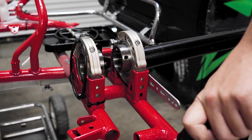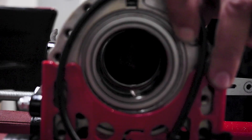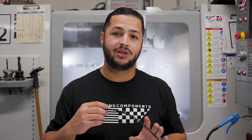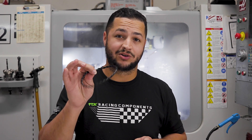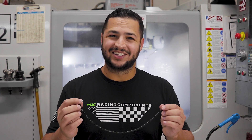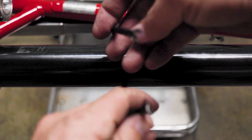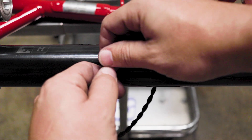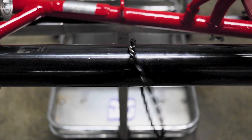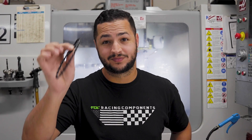Once the bearings are in line, take the axle and slide it through the sprocket side all the way through the third bearing. At that point make sure you don't forget the water pump belts if you're running an external water pump — that's one of those things I've definitely forgotten before. Luckily TDC has water pump belts with a metal clasp that hook together, so if you're tired of forgetting them or want ones you don't have to remove the axle to change, these ones are the way to go.